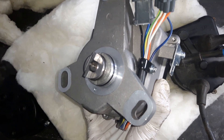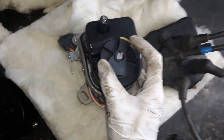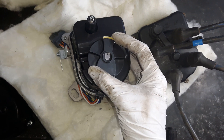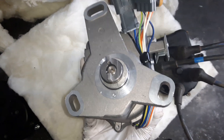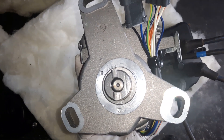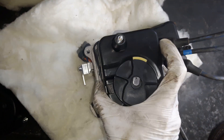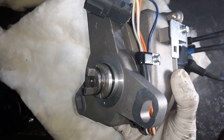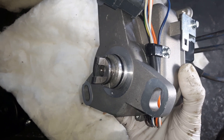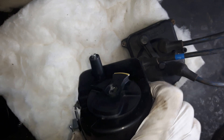This is the back of the fork — this is how the distributor has to go in. Making sure the fork is oriented this way ensures it's not going in 180 degrees off, because if we put it in 180 degrees off it will still slide in and you won't notice. So we keep the rotor near number one, then push it in — lubricate the o-ring a little bit with engine oil, make sure the mating surface is clean, and then slide it in.